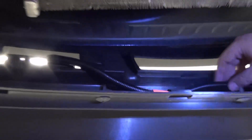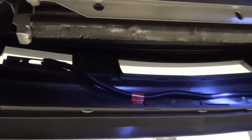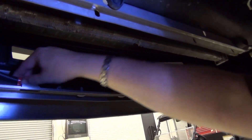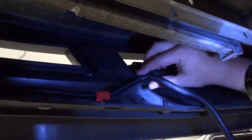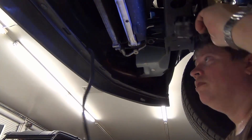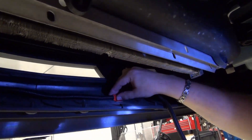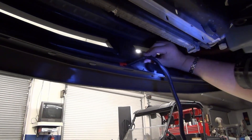So we got behind here — I've got all the cables going through this black tubing, and I took 3M tape since there's no place to zip tie anything under here. This 3M tape is going to stick and keep this cord there. I'm going to put some electrical tape here, and then we're going to fish this up through the engine anywhere there's no fans or heat, and go to the battery. That 3M tape is stuck right now — I don't think it's going anywhere. It is dusty but it'll be alright. I need some electrical tape to tape this up real good.